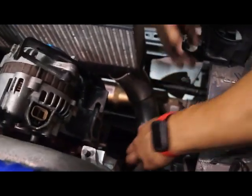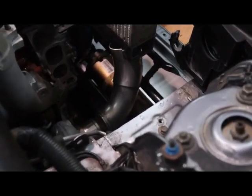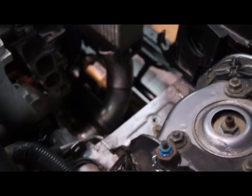That looks pretty good. That's where it's at right now. Are we far away from the sway bar? A quarter inch. I could cheat it a little better, maybe another eighth. It doesn't need to be much. Worst comes to worst, you could just mark it right there and put a lump in. It doesn't matter, it's just going to create clearance. It's not like we're going to make a new pipe. But that's what I wanted right there.